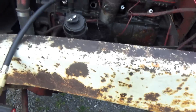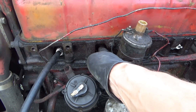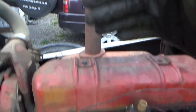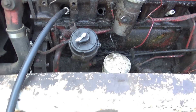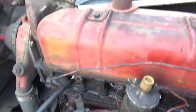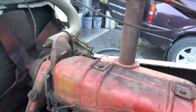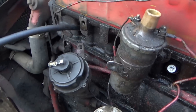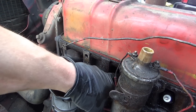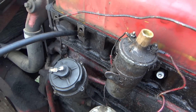We've got some compressed air. So where is it going to leak to? If it's a blown head gasket, it's going to leak directly to cylinder number 2. If it's a bad valve, it'll either come out the exhaust pipe or the intake. Let's turn up the air a little bit. So it's coming out of here, but that's a little misleading because if I plug the hole on cylinder number 2 — it's coming out of the exhaust and cylinder number 2. How do you explain that?